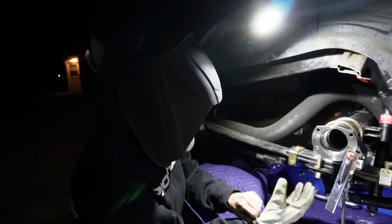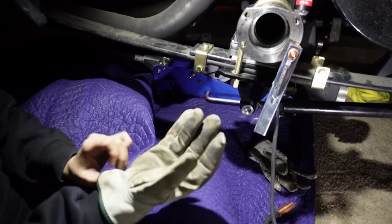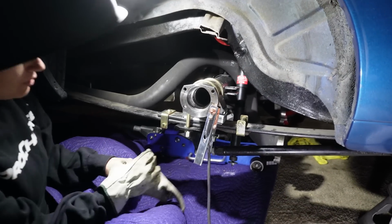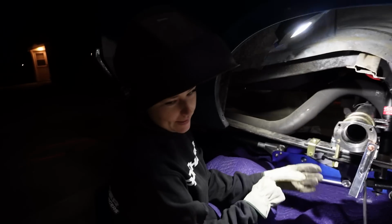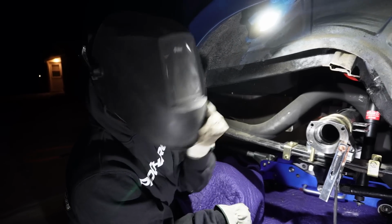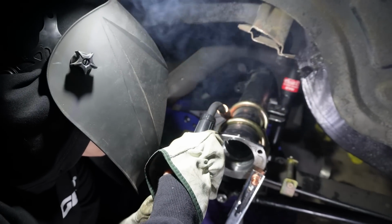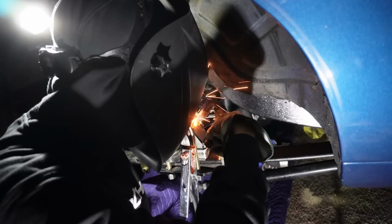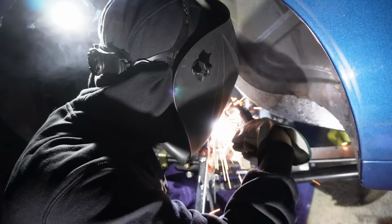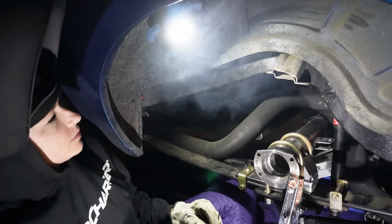I'm about to weld. I can't hear you. Pick up here. I'm about to weld. Hopefully, I'm welding the leaf spring perches onto the axle tubes of my 8.8 rear end. We figured out the pinion angle, set it about 4 degrees, and we're gonna make it permanent. So yeah. It doesn't have to be pretty, it just has to hold it while we pull the rear end out.